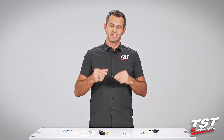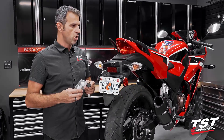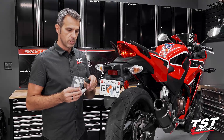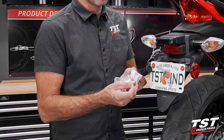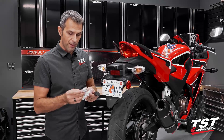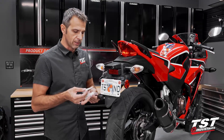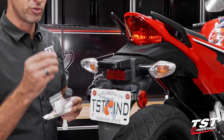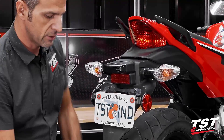I'm really excited to show you just how easy this is to put on and configure, so let's get started. On the CBR300R we'll be using the universal version of our brake light modulator. The universal version gives you a sub harness terminated in Sumitomo MTW 110 plugs, along with the opposite plugs that are typically crimped onto wiring in a universal setup. I'll show you how to use one simple tool to re-pin a couple of connectors and get plug-and-play functionality with this kit.